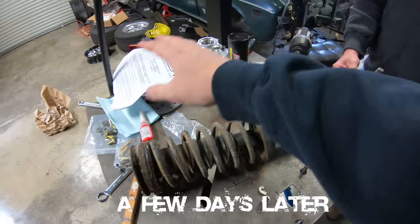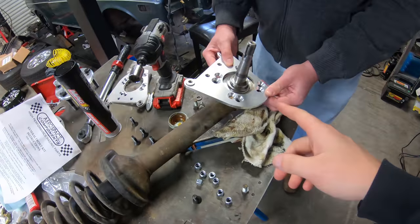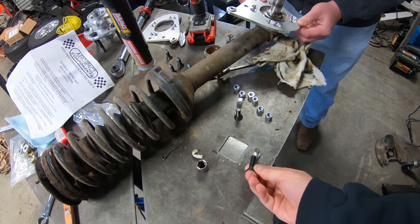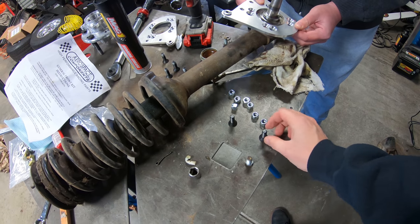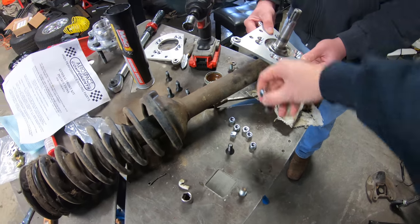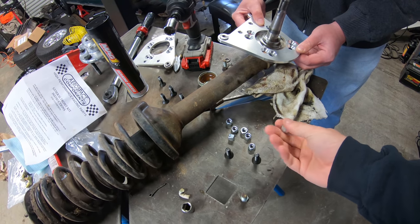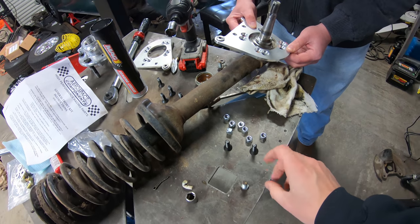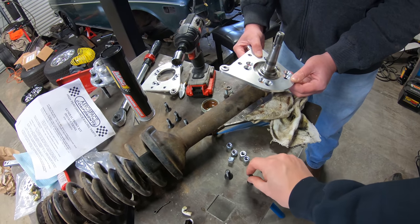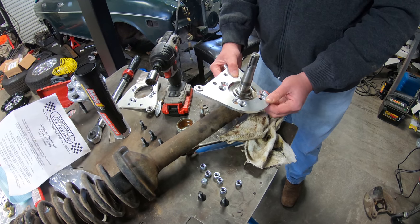This is the Aerospace brakes kit — got all the instructions, all the bolts, starting to get it put together here. Ran into a little issue though. I talked to Aerospace and they said you drill and tap this, but the stock bolt is almost the same size as this bolt, so once you drilled it out you wouldn't have enough material there. And then this going on the back side of it — I didn't know if they wanted me to drill this completely out all the way and then just put the nut on it, so then you actually have no threads. I don't quite like that idea either. So I'm going to run across town and see if I can find this bolt with this thread and get some nylon nuts, and then it'll be what I feel is sufficient.